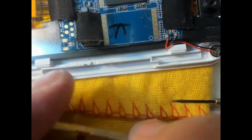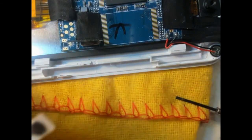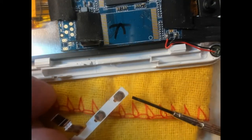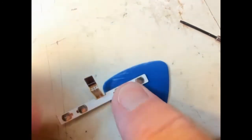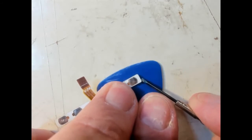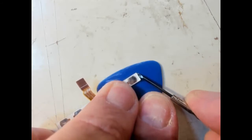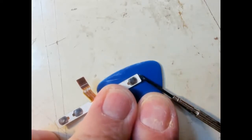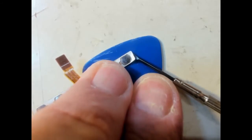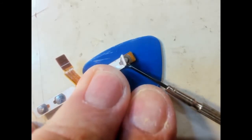And we can actually have a look at this switch, because it's got a backing plane and it's got a cover over the top, and it's that cover over the top which is obscuring the contacts. Let's just see if it will adhere to that, and then we may be able to just gently tease the cover apart. And we've got nothing to lose. Well, look at that, that's gently coming across. Let me just see if I can focus the camera, so I'll just be able to put the screwdriver into the cover there. And there's the contact.